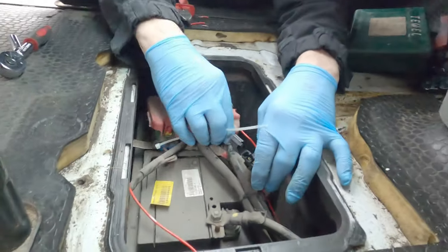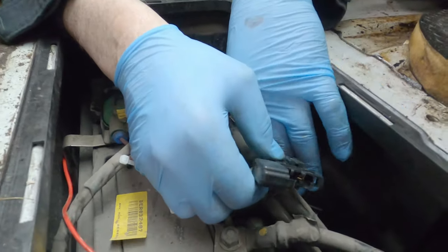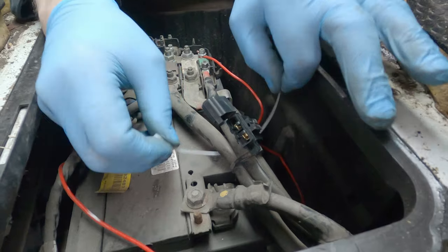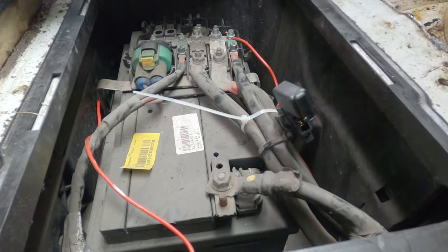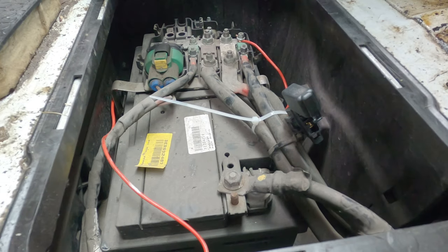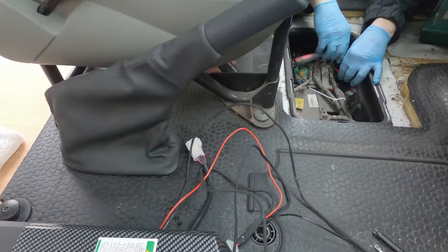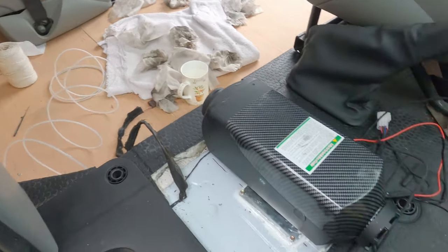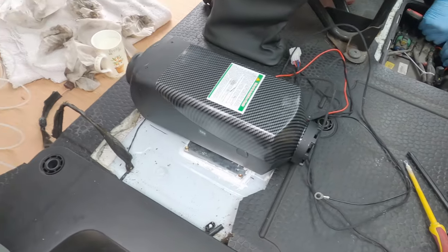Dad's just getting the live end connected up to the battery. You can see the new cable coming off the battery over the far side there. This is a little fuse carrier — this particular Chinese diesel heater came with an inline fuse carrier for the main supply, which protects the cable from overcurrent. We've got the fuse out of there at the moment because we've connected the live end to the battery and we don't want to get zapped. So the fuse is out and we're going to get on with installing the fuel tank and all the other cables, and then we won't be far away from testing.